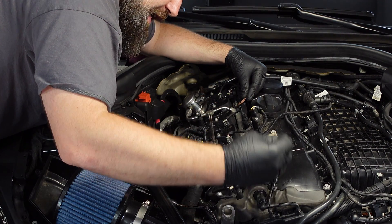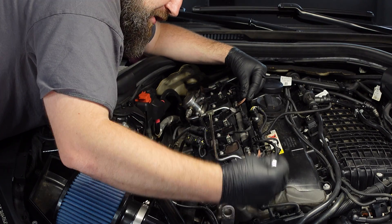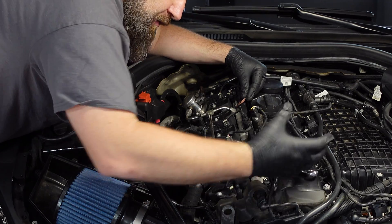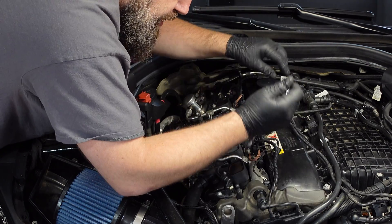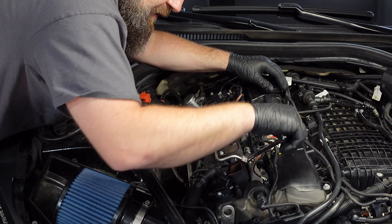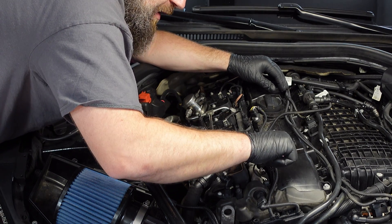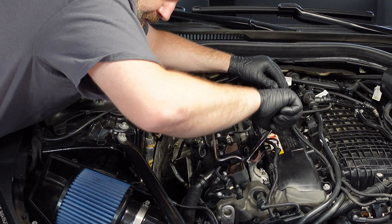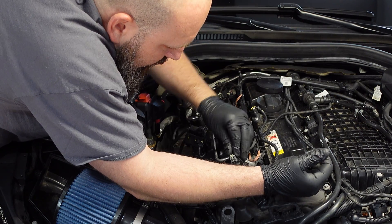You don't need to flash or do any special settings for the TU pump. It's going to automatically regulate it to the factory rail pressure. It's just that if you're running more ethanol, it'll allow a higher amount of pressure — it'll maintain the fuel pressure.